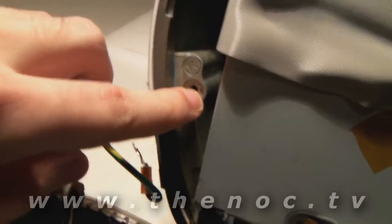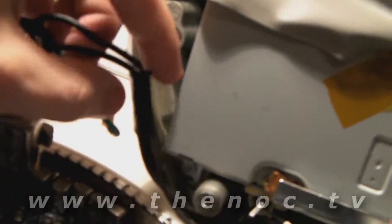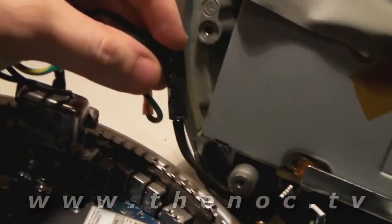There is another connection here that basically goes up past the CD drive. You can give it a little twist to loosen it up, then pull the two halves apart — that'll give you more access past the CD drive. Once you take the grounding screw out, you'll be able to wiggle that cable out from behind there. It separates in half. Once you take that out, you can start removing the CD drive.